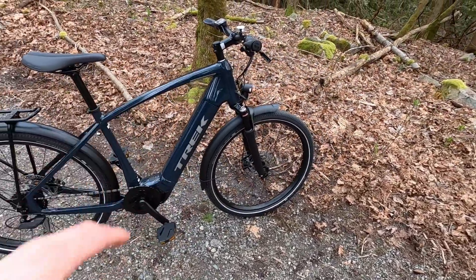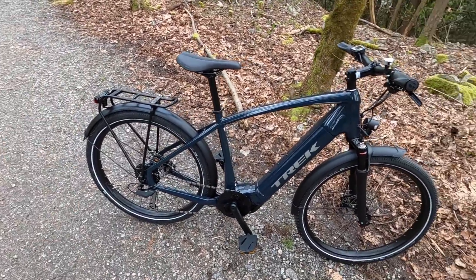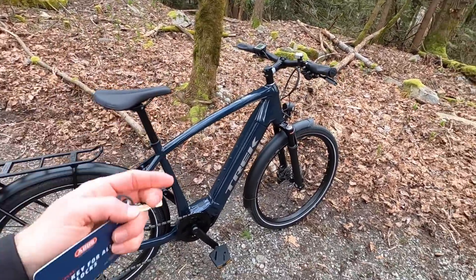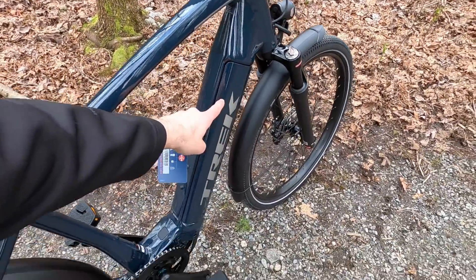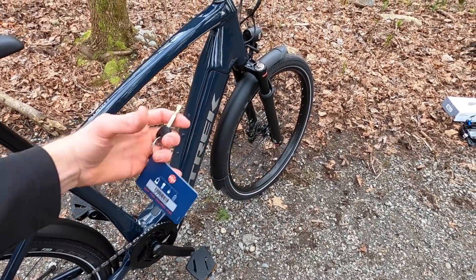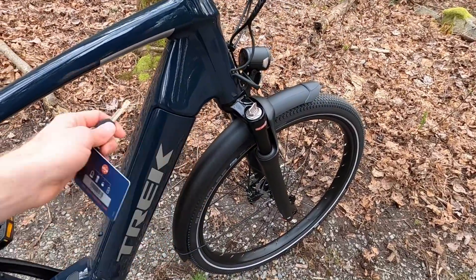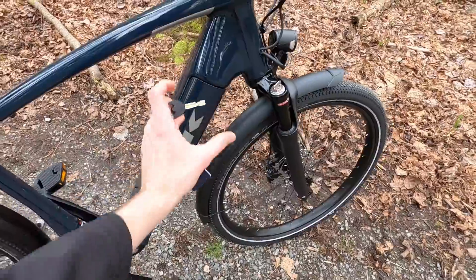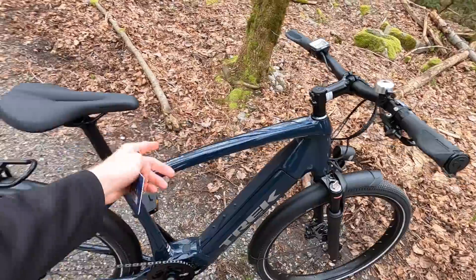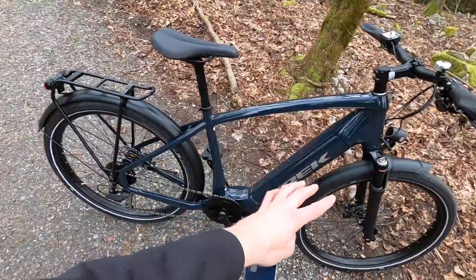What makes this bike a little bit more special than other hardtail light trail bikes is this whole commuter-trekking concept with so many possibilities. Trek has used this rib design — that's what they call it — a battery holster thing with a handle on top. It's really nice. To open the battery you have to come from the opposite side. They purposely made the battery come off this side because with trail bikes you actually lay it on its side — you want everything to come off on the drive-train side.